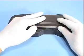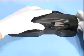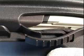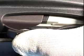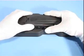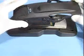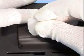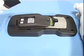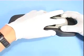Place the unit upside down into the opening tool and open the grip. Take SRT4 and press both levers so that it goes between the two covers. Then push the top side forcefully to the left. Remove battery cover. Remove B cover.